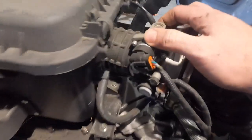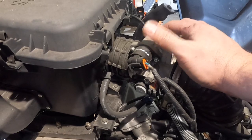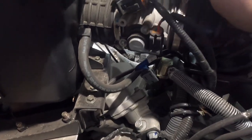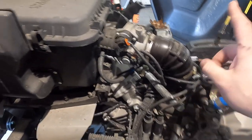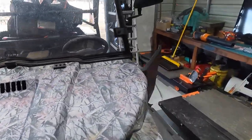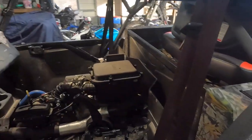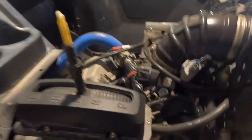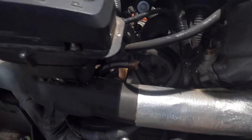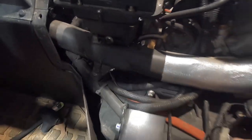There are your injectors — front and rear. The IAC motor goes out and I've replaced these when they never want to idle right; your IAC motor has a lot to do with that. Your TPS sensor here — mine was reading zero, which is good. Definitely check your intake tracks and make sure these aren't cracked in any way. Another big issue is with the PCV valve on these things — it's really cheap plastic. You can bypass that and just put a Y in it, which takes care of the PCV problem.